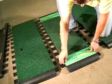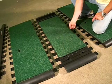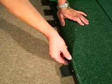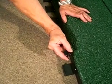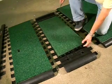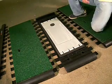Remove decal panels. Remove clips from the side of the surface. With the broad bladed screwdriver, release the clips. Repeat at the other end. Remove the strike surface.